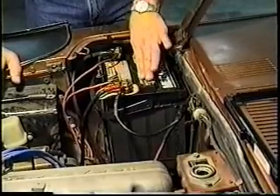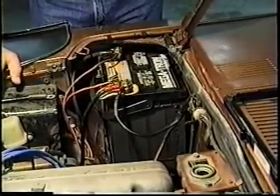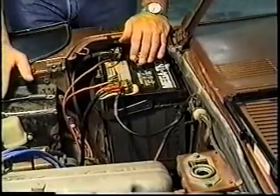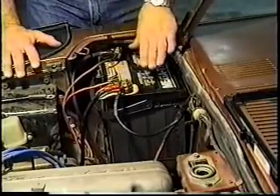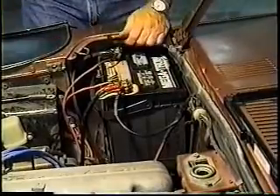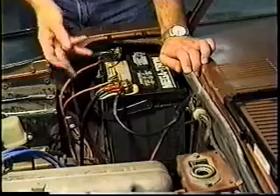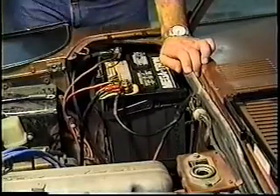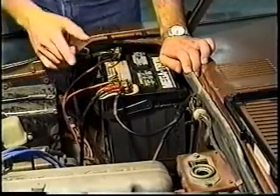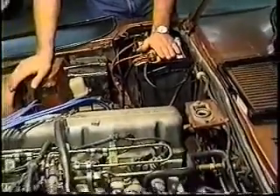But if you're driving a ZX, you must use the short battery. If you use the other one, you will eventually rust out the bracket. It will bounce up on a road or speed bump and short out, and in the count of one, two, three, you will have no wiring left in the car. The moment it shorts out to the chassis or to the hood, you're going to flood the entire body with all the amperage the battery has, shorting into the body. It's going to look for a ground any way it can get back to the negative side — and it's going to find your fuel injection, fry that, and any circuit that's on — your radio, lights, taillights, signals — anything circulating positive power will be flooded with over-amperage in the other direction and burn every wire down. The throttle linkage will get red hot, it'll use your speedometer cable and wipe the hairspring right out of your speedometer. This is a serious, serious problem, and one that is very easily avoided.